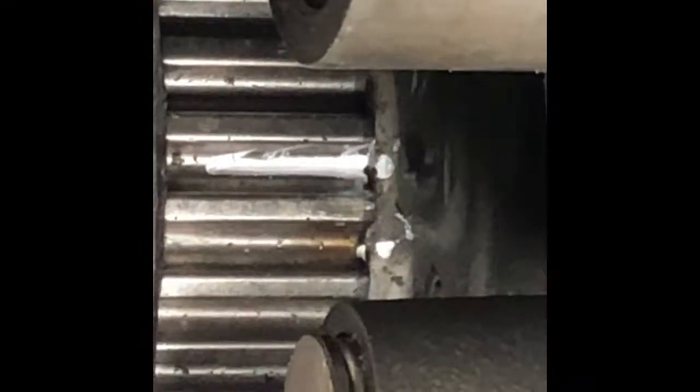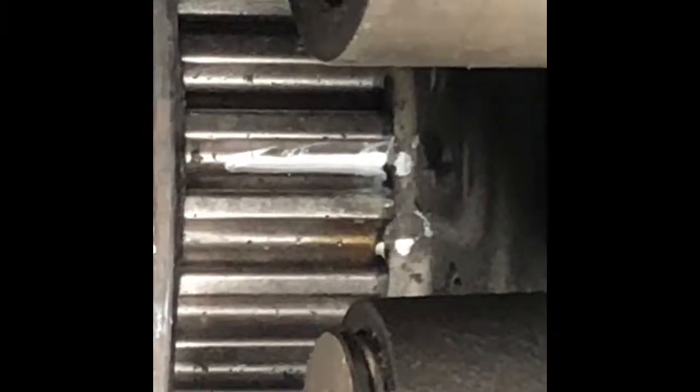On the crank alignment you can see a very thin little divot - a little V on the inside. I've got it highlighted and there's an alignment mark on the oil pump itself. There's an alignment mark, you see it right there, kind of dead center with that V in the pulley.